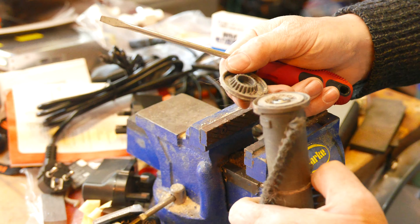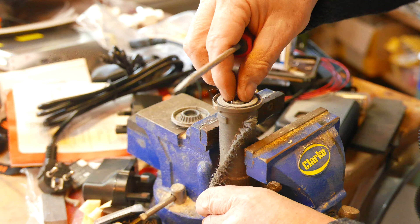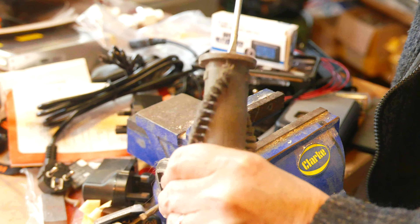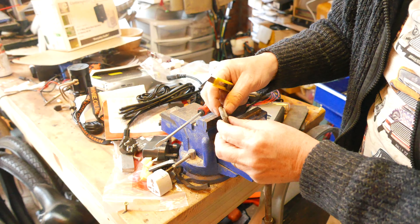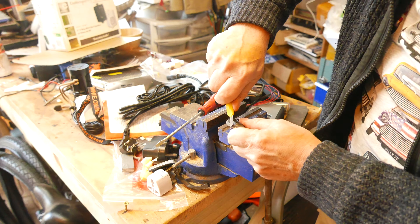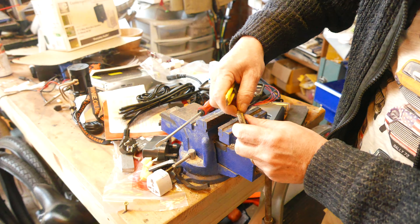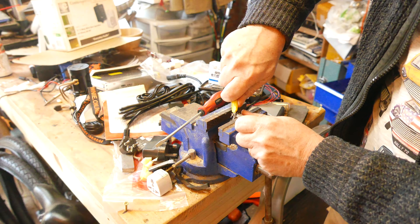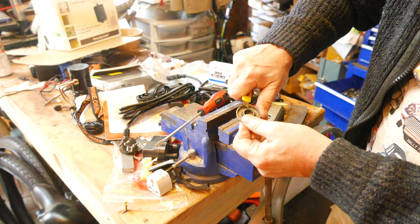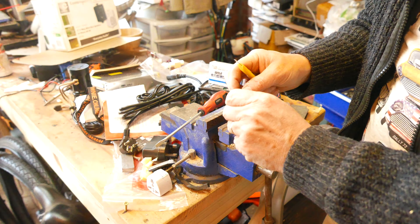What's happened here? You can see that this has seized in the housing. What I'm going to have to do now — you can kind of see what the plastic should look like — all of this crud is built up around the edge. It's pretty fused to the top. It does come off, but it takes an awful lot of prying. It's almost like it's welded itself to the top. I'll get all this off. As you can see, it's coming off cleanly, and there's also a bit on the surface that needs to come off. Back at the Vax once I've cleaned this up and popped it back onto the bar.